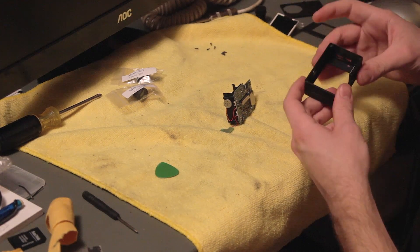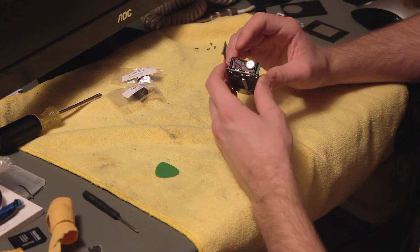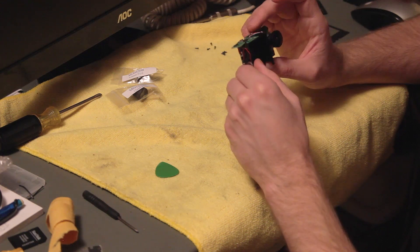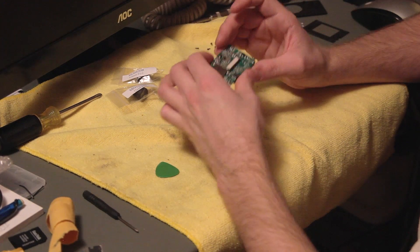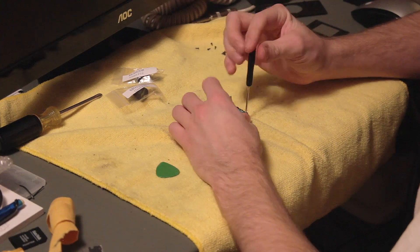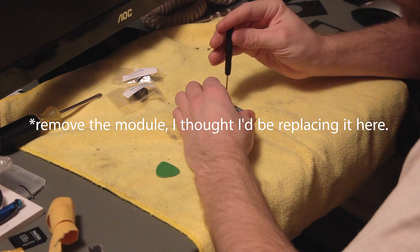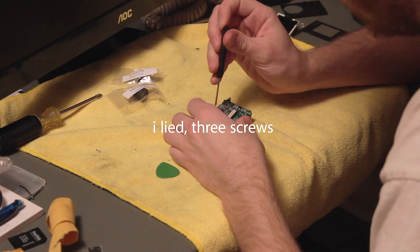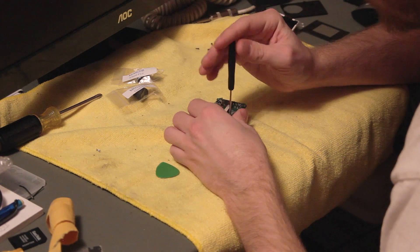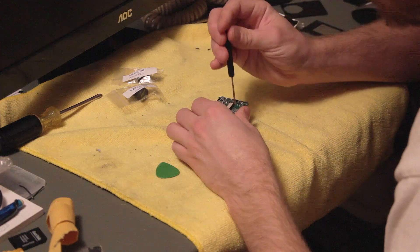Bend this side away from those sockets and push on the micro SD slot — you want to be very gentle but it takes a little doing. There we go, that's out. Now we can pull off the battery holder. The battery holder has a couple things attached to it, so don't completely separate it — you don't need to pull all that off to change the camera module. There are four chrome screws here, different from the black-finish screws on the front, so I'll keep them separate.